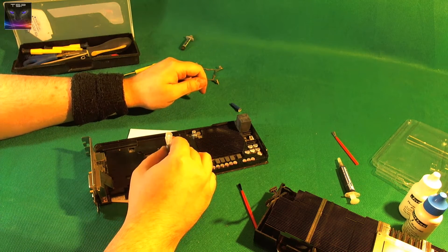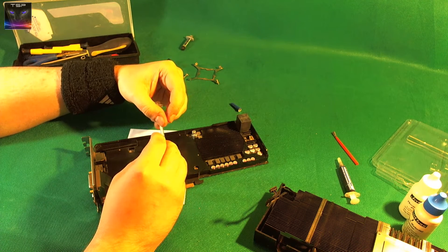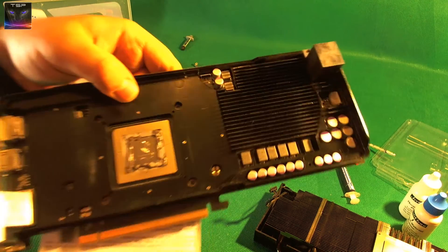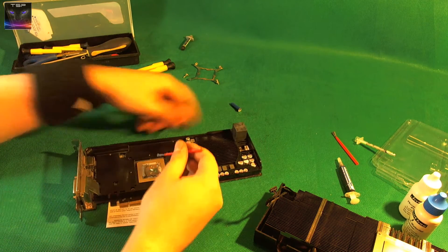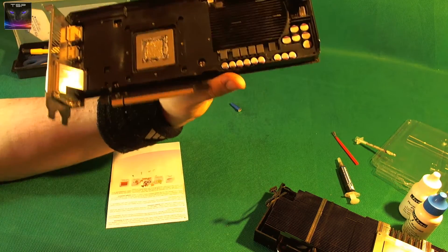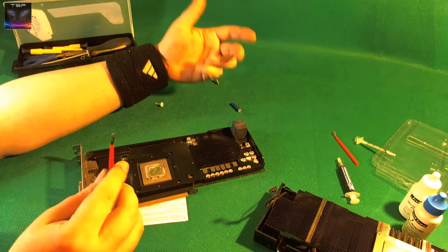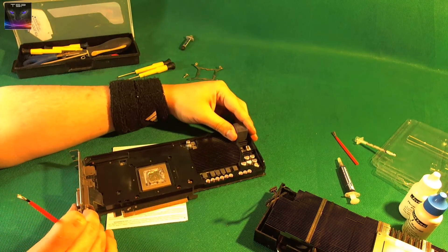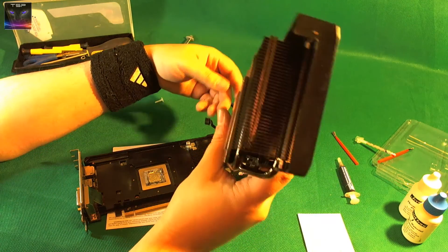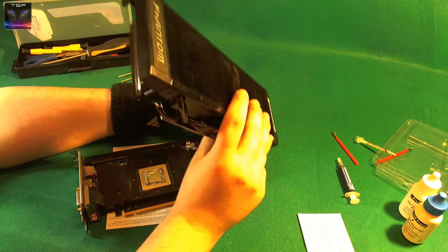I hope I got enough out — I don't know why it was stuck. That should do it. I think it just ran out but I should have enough. You can see it — it's like Quicksilver. And this is how the final result looks like. I think I'm done. All I need to do is put the heatsink back on. Let me just examine it — okay, it's done. Let's put the brushes away and put this back on. First I need to put the fans back on.